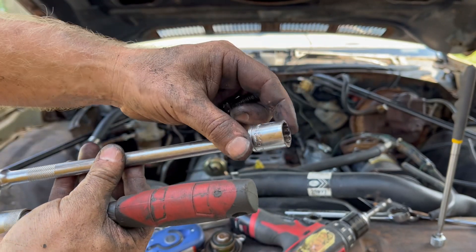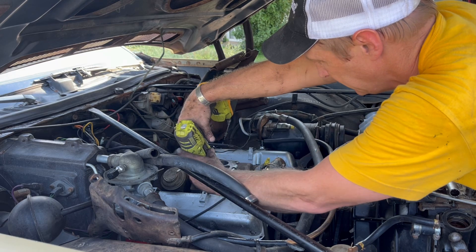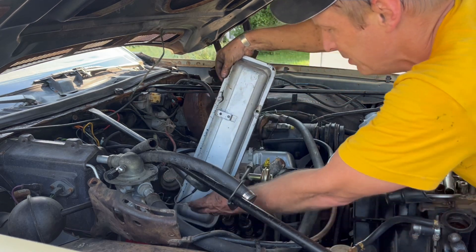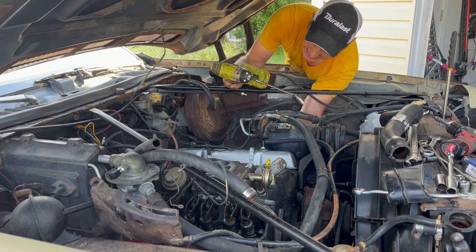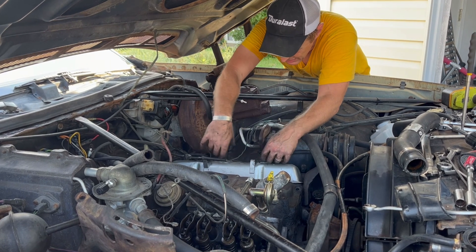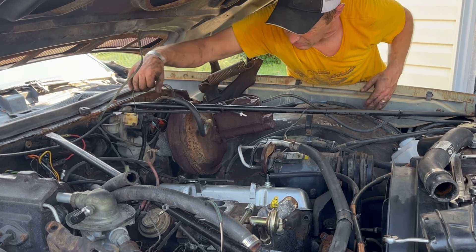Modify your tools sometimes — take your socket, grind the chamfer off the end so you've got a good grip all the way to the edge of that socket. Sometimes that works. Next thing you gotta do is strip these valve covers off so we can get this intake off. There's one beautiful valve cover. I just dropped a socket right down into the coolant — that happens every time. At some point in the job you always lose a socket or a wrench down into your coolant. That's just automotive law.